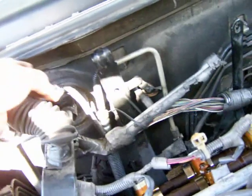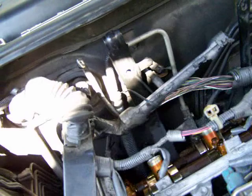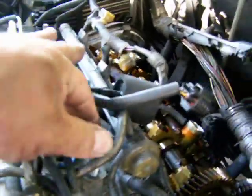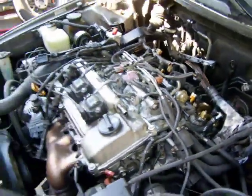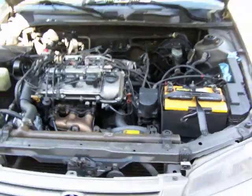That's pretty much it. I didn't have to drain any coolant and didn't even disconnect the battery. There are a couple of things — this ground goes to the back of the intake, right on the side, easy to get to. I believe that's a 14 millimeter and the other one is a 12. You've got assorted vacuum line plugs, and here's the one I had to cut because it was hard as a rock. Just carefully slice them off so you don't take a chance of breaking those fittings. That's about it — it's a 99 Camry with a V6.